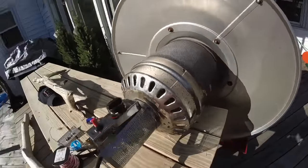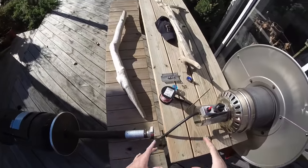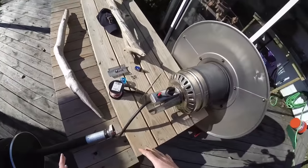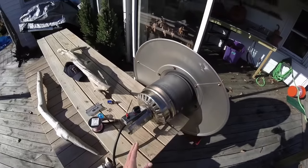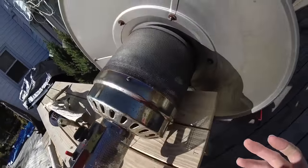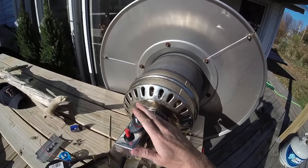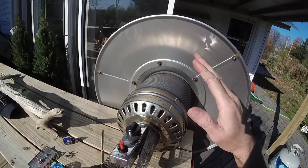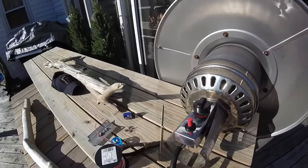What we have here is a broken patio heater. You usually see these at restaurants — they stand up pretty high for people who are going to smoke and hang out outside without freezing to death. It's been working great. We've had this about a year, and as of the last couple days I went to try it out and lo and behold nothing happens. The igniter is working. I believe the gas was coming through just fine but something was stopping the pilot light from lighting and creating the flame.